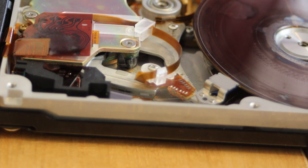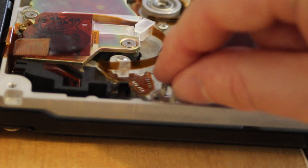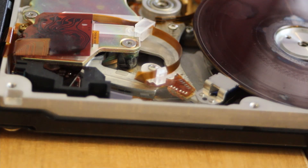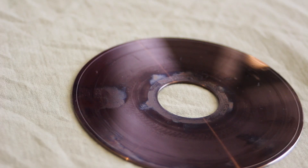As for the rubber stopper in this one, when I opened the drive the integrity wasn't too bad — it's very soft and about to melt. But in other drives I've found this melted all over the place, just everywhere inside the drive. This one just needed a little bit of extra integrity so I put some tape around it. This did actually stop the head from sticking — this arm gets stuck on it, and even if only momentarily it stops the drive from functioning correctly. So normally what you have to do is replace that rubber stopper entirely with something that's not going to stick to the metal.